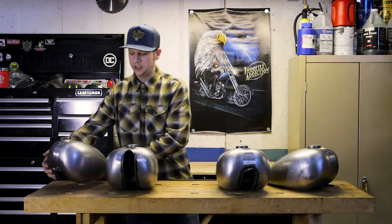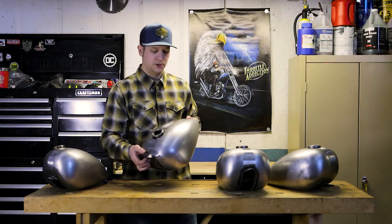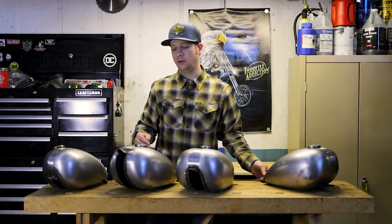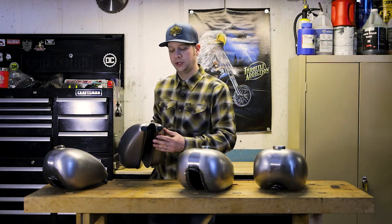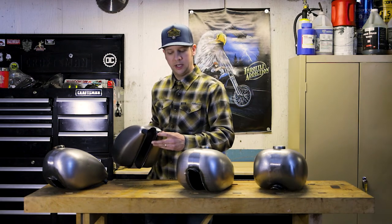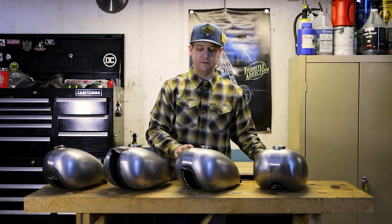All of these gas tanks are fitted with a cam style Harley-Davidson gas cap bung, so it is not true to the original Wassel with the British style. These have all been retrofit with the more easily available Harley cam style gas cap. And on the back, they're all going to have quarter inch NPT petcock bungs — not stock replacement British threaded bungs, these are NPT for national pipe thread, so more of your US American style parts would fit on these.